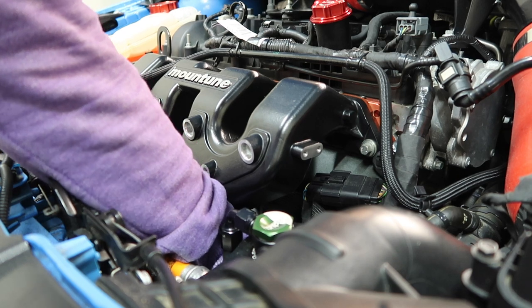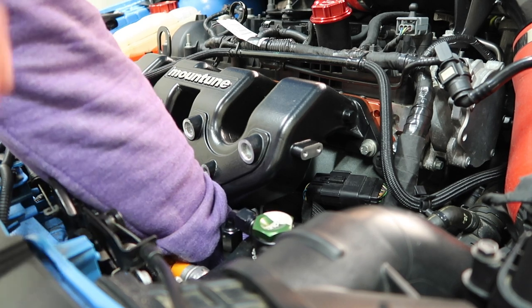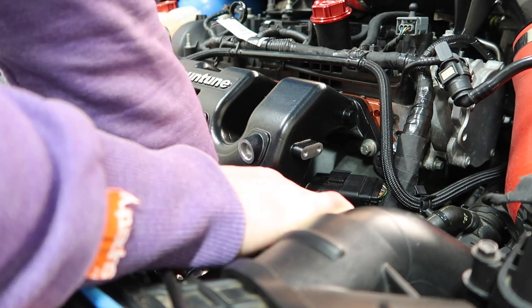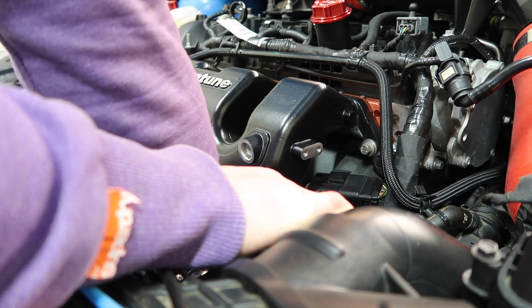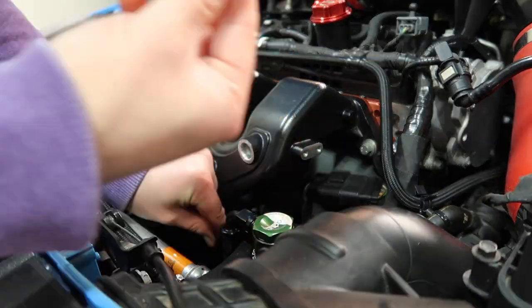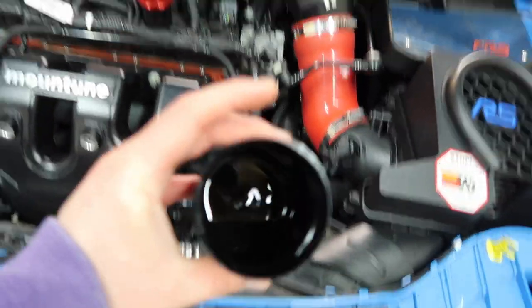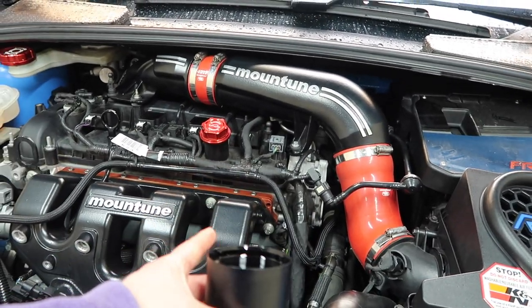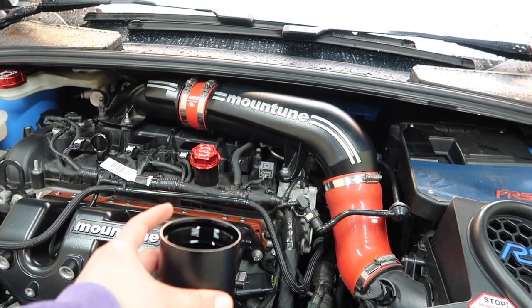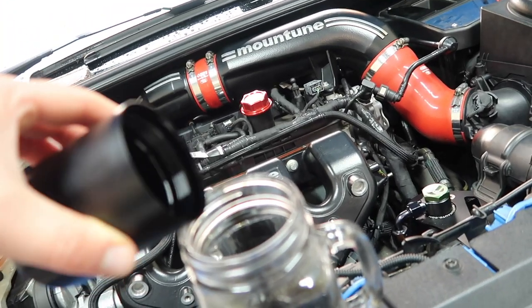Just a little bonus segment — I'll see if I can get the can off now that we've emptied it. I can get in here and unscrew it — interesting to see if I got all the oil out using the syringe method or if there's much left. There we go, that's it out. There is a little bit left in the can but I pretty much got it all. Like I said, if you are running the stock intake manifold that would pretty much be too tight — almost impossible — so you'd need an alternative method of removal.